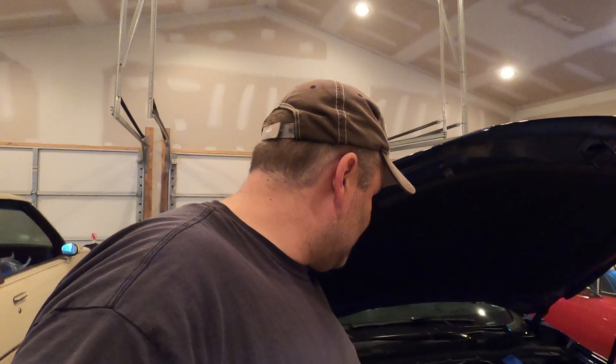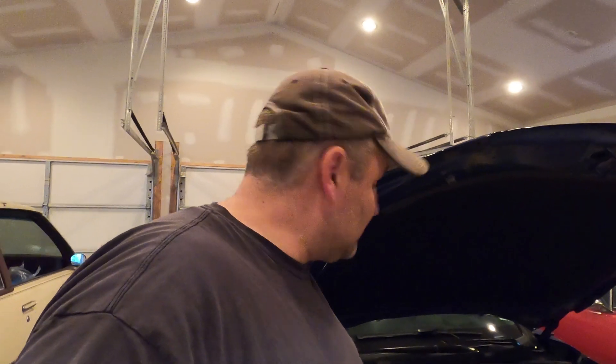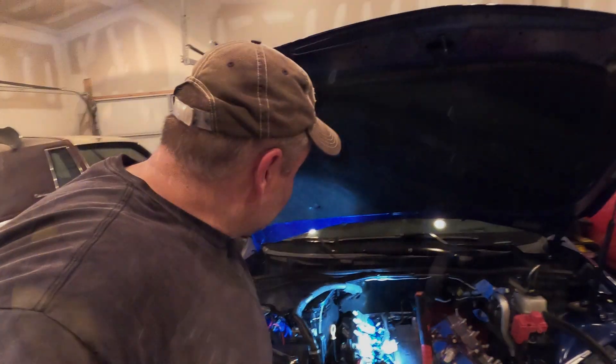Most of the wiring's out of the way and then we're in the home stretch - we'll pop this off, drop the exhaust, start draining it, and off come the heads. One small issue I'm dealing with is the catch can. The hardware they give you is garbage and the bolt's stripped out - the hex head itself is stripped. I'm not 100% sure how I'm getting that off, but I disconnected all the lines, so I'll probably take the whole thing off with the head and deal with it on the bench.